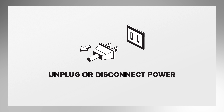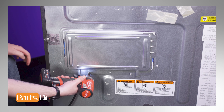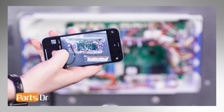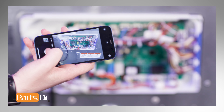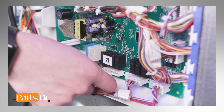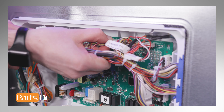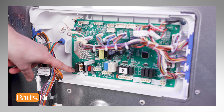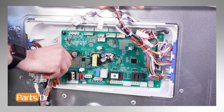Next, we will be removing the main control board. Since we will be working with the refrigerator's electrical components, disconnect the power to the refrigerator. With access to the back of the refrigerator, remove the screws holding the main control board cover in place using a quarter inch nut driver. Because the main control board is connected to so many wiring harnesses, take a picture to reference later to make installation easier. Then disconnect all electrical connectors by depressing the locking tabs. Next, remove the screw holding the control board in place. Remove the control board by swinging the left side out and then pulling gently forward.